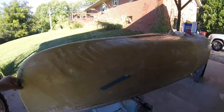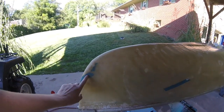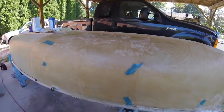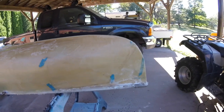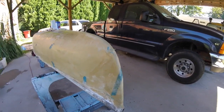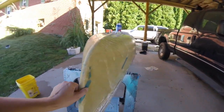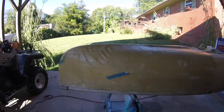I did take off all of the wax paper on the inside — that worked like a charm. It came off, so it was really easy. But a couple of my pieces of tape did get encased and caused a couple of little flaw issues. So maybe don't use blue painter's tape if you decide to do it this way, because apparently the resin goes through the tape. It didn't go through the wax paper — the wax paper worked really well. This tape is actually between the two layers because it was so windy. It's going to be painted so it won't matter, and if it causes a condition issue later on we'll just cut those pieces out and refiberglass over it.